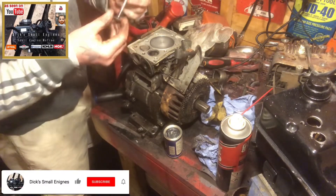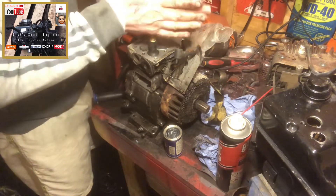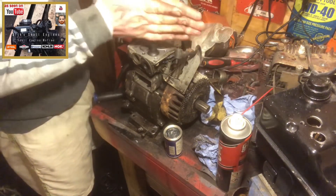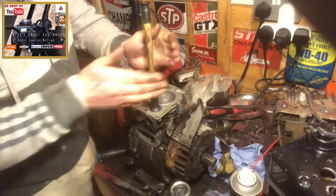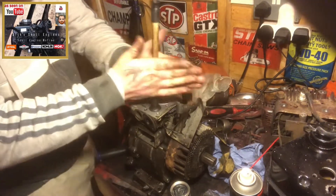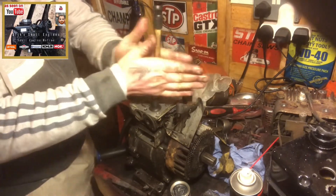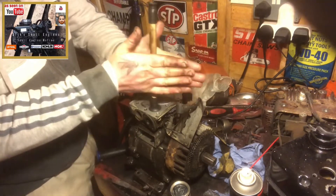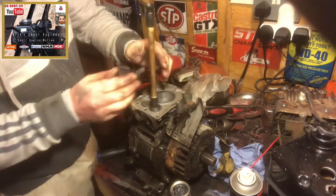Work it around again with your finger. Drop the valve back in on the stem, get that bit of suction again, and then keep working the valve all around. Try and lift it up a bit — you can see what I'm doing, working it around. You can hear that paste working its way around the valve and the seat, just trying to iron out any potential pitting so that the valve seals as it should, trying to avoid any low compression on our engine.